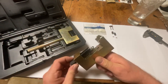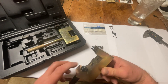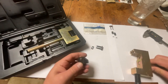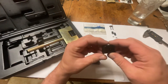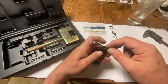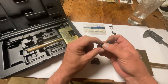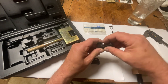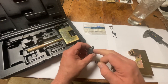This tool here, on the other hand, is much simpler. This is the one which actually makes the rivets, and that goes pretty simple. On this one here, this pin cannot be changed — that is stationary or fixed, and it only serves as a guide. And here we have the actual die. You can see this has an imprint on it. They have another plate which you can set in here. On some chains the plate you put on here cannot be easily pushed through, so they use this to push the lock plate over without making a rivet yet — just to clamp it onto the chain.